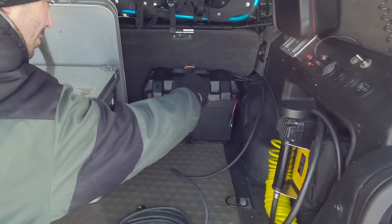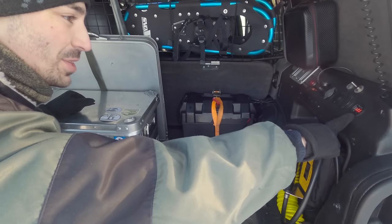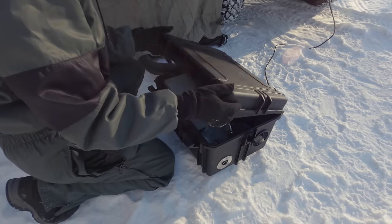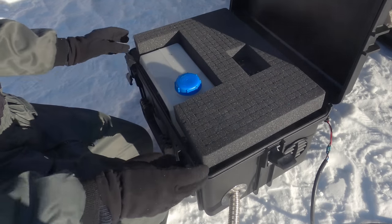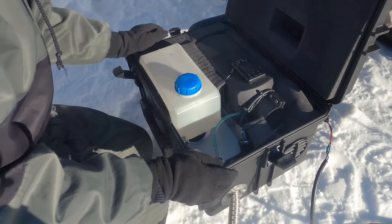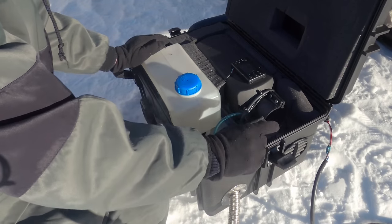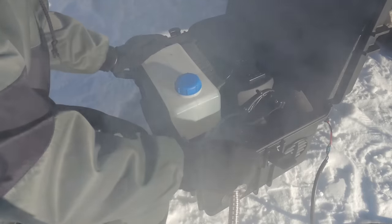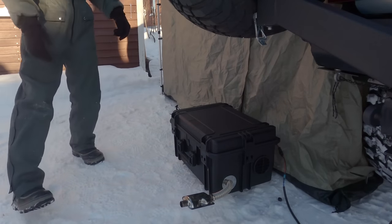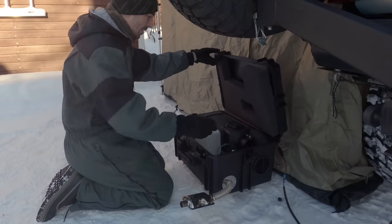This is the leisure battery, connected up to a split charger under the seat that charges the battery. We're at 12.6 volts, so as you drive you get a little bit of juice in it. Let's see if we've got power. Sounds like the unit is firing up now — the pump is going. It's blowing out a little bit of smoke to begin with, because the air filter was blocked with diff oil, the air-fuel mixture was completely wrong, and it just blew out plumes of smoke. It's going to burn off a little bit of diesel and seem smoky for a while. It's been running for about half an hour on 4.8 hertz.